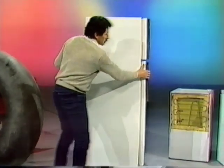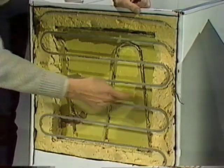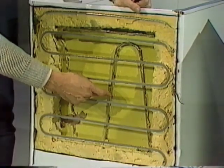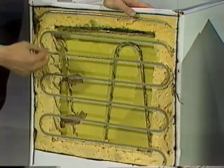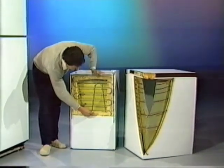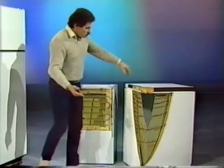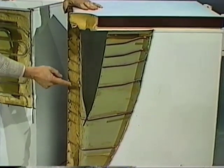If we look at a freezer that's had the wall cut away, you can see both sets of tubes very clearly. The inner set of tubes are close to the evaporator, and it's in those that you get a very cold fluid circulating — heat is taken away from the food just inside that thin wall. On the outside, here are the tubes where compression has occurred, so these are quite hot and the heat escapes through the thin outside wall. Between the two sets of tubes, of course, there's a thick layer of insulation so that the hot tubes don't make the cold tubes hot again. Another freezer also shows us the two rows of tubes — the inner ones are made of copper, well separated from the outer ones by a layer of insulation.